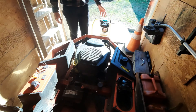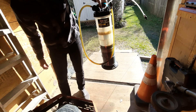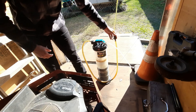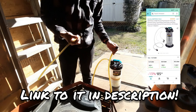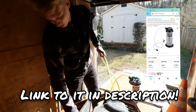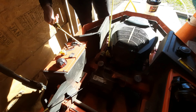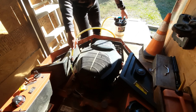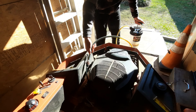So we hopped on Amazon and we picked up this oil changer. As you can see, it's kind of half full — we're going to empty it out after we're done here. It comes with different heads on it so you can change it depending on your use. All you do is stick it into the oil reservoir where the dipstick goes, hold it all the way down in there, and when you pump, it creates a suction vacuum which draws out all the oil.